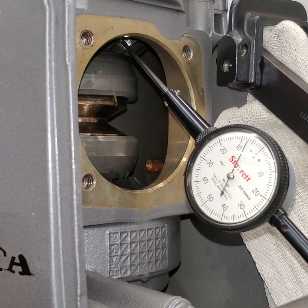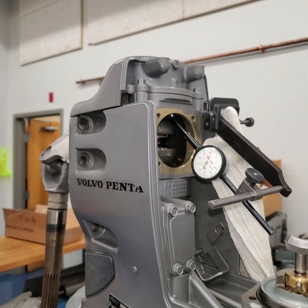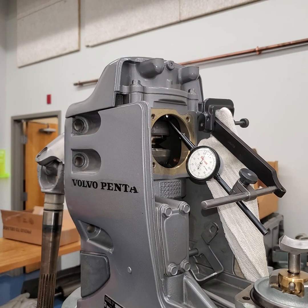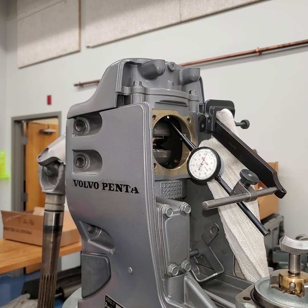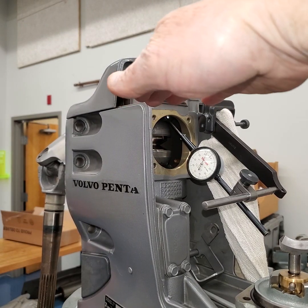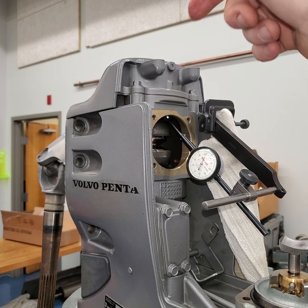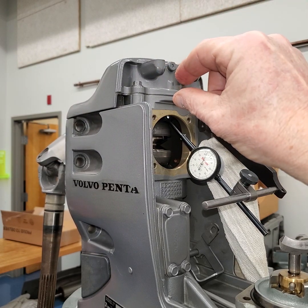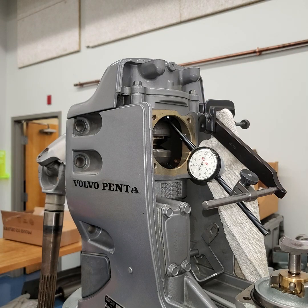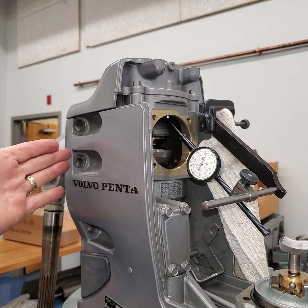The drive is fully assembled — I've got it all back together. I've shimmed the lower gear, got the lower gear measurement, got the upper gear measurement, done the top cover preload measurement — that's the crush on the top bearing — torqued the top nut, and measured the height from that top nut down to the shaft, which is the play in the shaft that can go up and down a little bit. I've also measured and shimmed the pinion gear while I was out of the case.